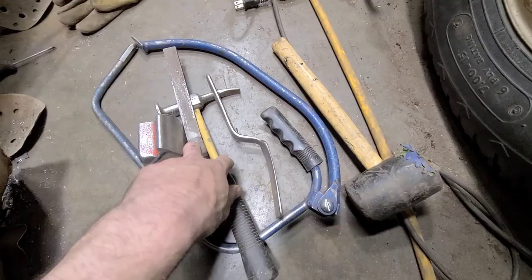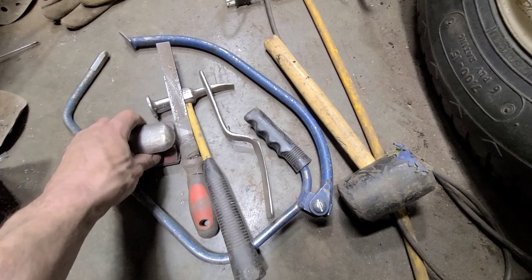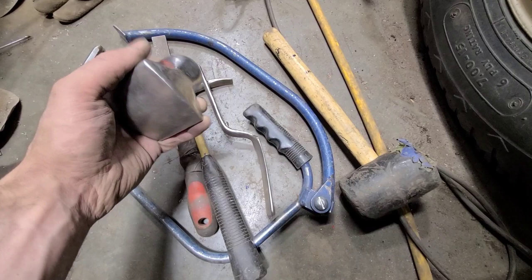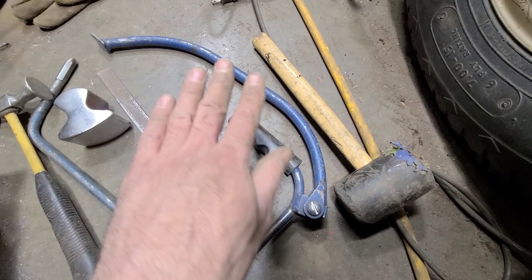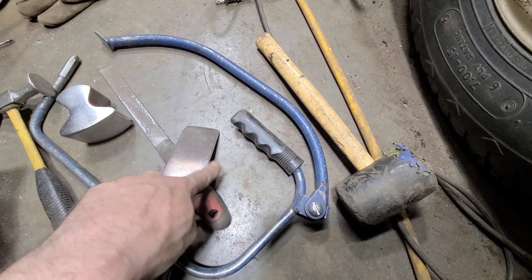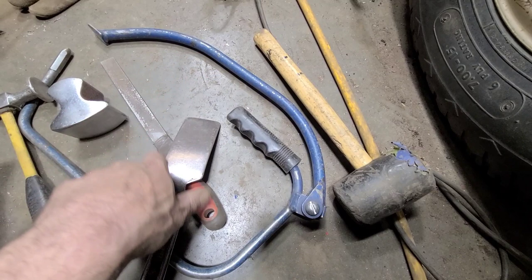This is just an overview of what we use for tools. We start out with our least aggressive rubber mallet method, and we just used one of these general purpose dollies. I use mostly this edge, a little bit of this edge, regular old hammer, body spoon. I use this as a slapper when I've got like a ridge going around a dent or just any kind of damage like that. It's a wider contact surface than the hammer, so it works just the same as a hammer. It's just a wider contact surface. Works really good for ridges and things like that in the metal. Ironing that out.